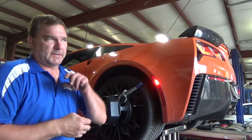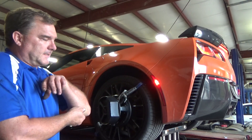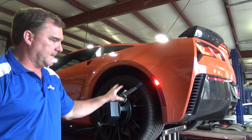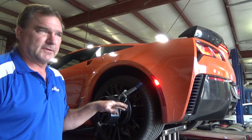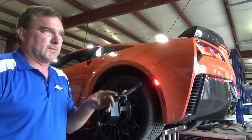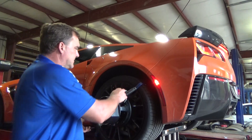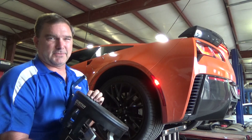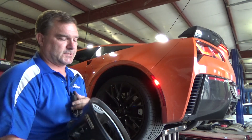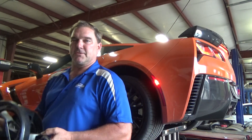To get a little better camber on the back, I'm splitting hairs, but I'll pull the heads off. I never set my alignment heads down on the rack - I try to keep the rack clean, but every car that rolls on picks up little stones from the parking lot that come off on the tires onto the rack. I'm always cautious because it's hard rubber - I don't think it'll pick up anything, but I don't want to set a head down, pick up a stone, and put a mark on the customer's wheels, because wheels are usually expensive.